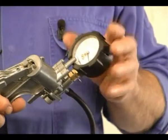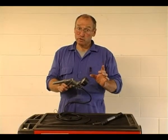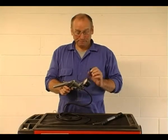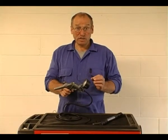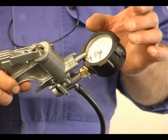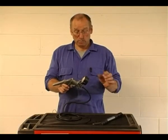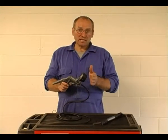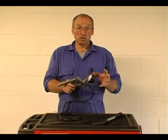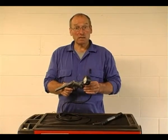So we would use this gauge, probably supplemented with a more accurate gauge than this — we have some calibrated gauges which we have handmade and built — and then check the voltage output from that device. If we suspect that the engine is a problem, we're also able to connect this to the manifold sensor, provide the correct vacuum, and then watch the fueling response independently while monitoring the engine vacuum. What we've done is interrupt the link between the engine and the electronics by introducing an independent vacuum from this pump to the device or sensor, which then allows us to independently assess whether the problem is both mechanical and or electronic.